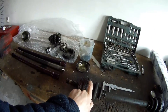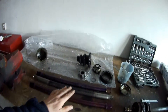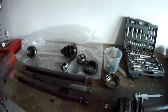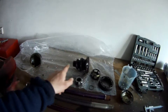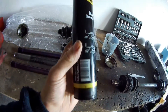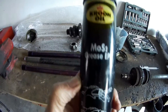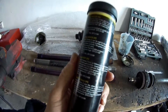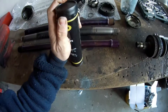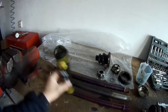There is also an O-ring underneath, so don't weld it completely through. So what I'm going to do now is assemble one axle. It's a very messy, dirty, greasy job. You need to grease the internal joints with special grease — I will show you that. This is what I use — it's a special grease; you cannot just use regular bearing grease. It's a very dirty black grease.